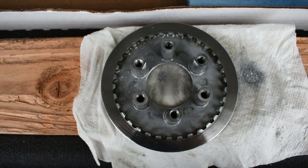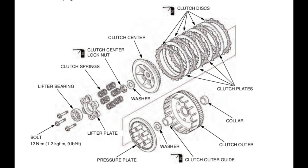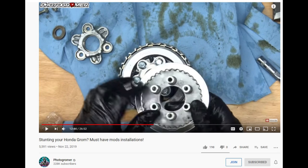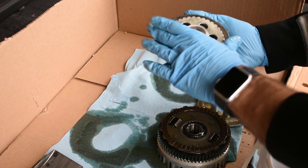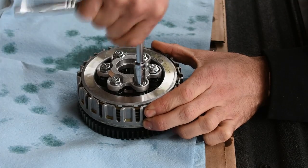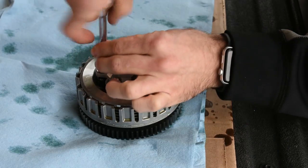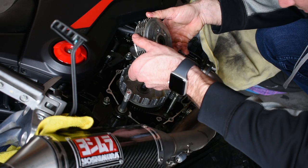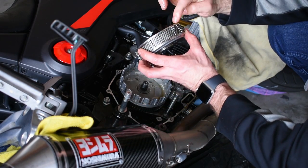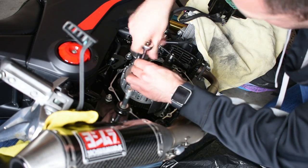Give your pressure plate a bath with hot water before reassembly to remove the shavings, then put a little oil back on it when it's dry. The order in which you reassemble everything is critical — I would highly suggest watching the Photogrammer video I referred to earlier, as he does a great job explaining how all components go together. I ended up assembling the clutch slightly differently from him and here's why. He assembles the pressure plate, discs, and clutch middle all inside the basket and tightens the springs down with the lifter plate before installing it back on the bike. The problem is if those outer clutch notches aren't in perfect straight lines, the whole assembly will not go down into the clutch basket all the way. We initially fought the clutch assembly for 10 minutes before figuring out the top disc was off just enough to not let everything properly seat. We ended up loosening those bolts until the discs would move, then everything finally seated correctly.